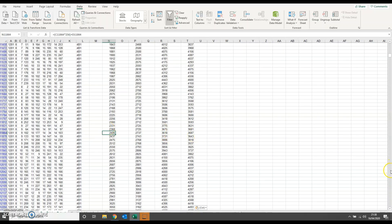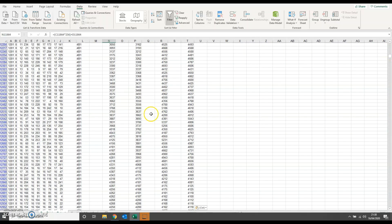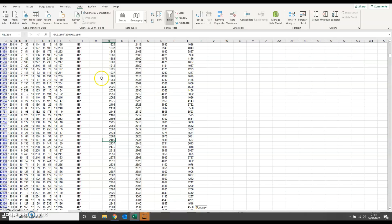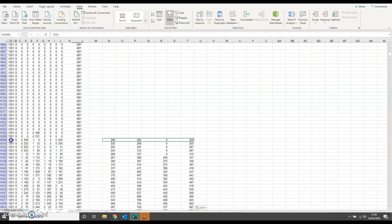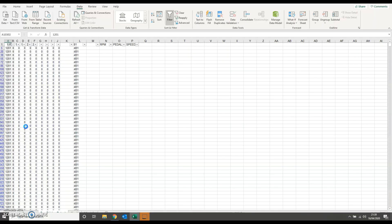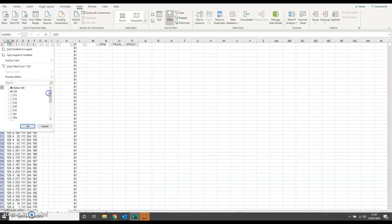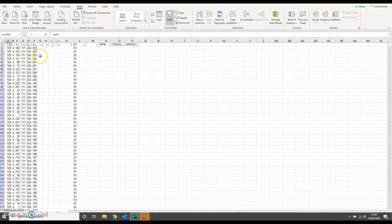It's quite interesting looking at this - the wheels aren't all spinning at the same speed. I don't know whether that's differences between cars or a problem with the sensors on this car, but the wheel sensors feed into the ABS system which then pumps out this packet of information as code 1201 on the CAN bus. It would flag if there was a problem because you'd get the ABS light on the dashboard. But this is where you could immediately use the Arduino to intercept these messages to update the speedo on the dashboard. When you first come to this you're not going to know that, so it is simply a matter of picking these codes and looking at them.